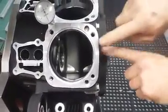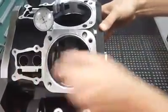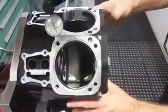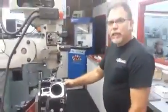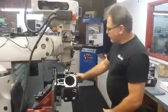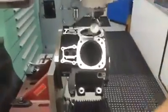You can see it pretty pronounced here — it's about a two thousandth step from here to here, right in the middle of your gasket surface. That will cause some seepage around the corners. So when you're thinking about having your casework done, make sure you talk to whoever is doing it and have them check all of your deck surfaces. That is a very crucial area to help keep base gaskets sealed.